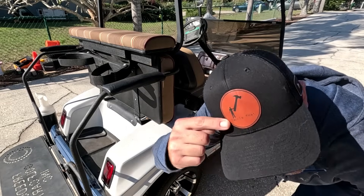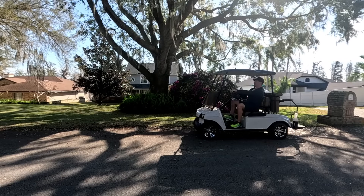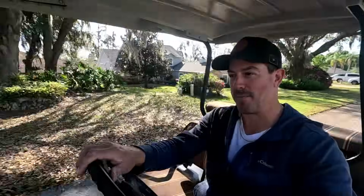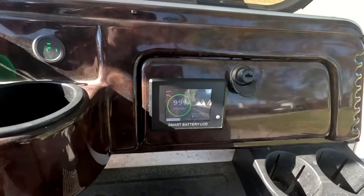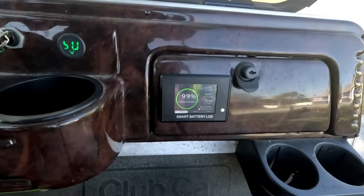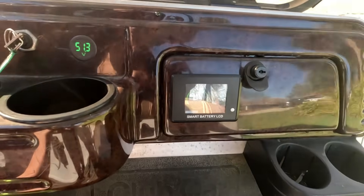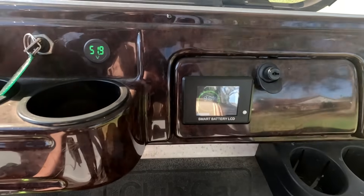Today's the day — it is done. Let's give it a rip! Just pulled out of the driveway and I really want to see what kind of power this thing has. A bigger battery gives you more acceleration because there's less voltage sag, especially compared to lead acid. Oh yeah — instant torque, no problem. This thing would be able to go up hills on the golf course. At mid throttle it's showing about two and a half to three hours of run time, and going uphill it adjusts — probably four hours just cruising around.